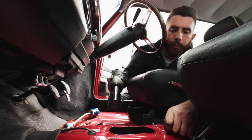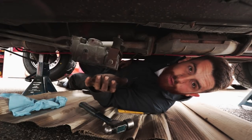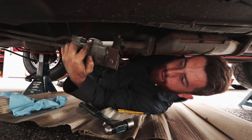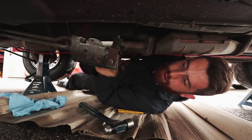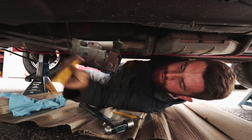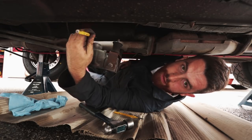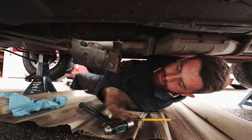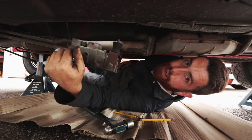The housing has dropped down and now we can go under the car. You can see right here is the roll pin that we need to knock out — there's one on this side and one on the other side. With it hanging down we can use a small punch and just knock it out. I like to knock it from the outside in to the housing; just make sure that you find it afterwards. Sometimes it can be helpful to put a bit of shop towel inside just to catch the roll pin when you knock it in.